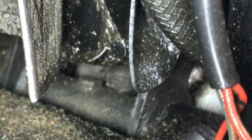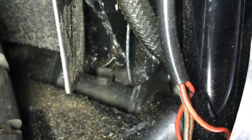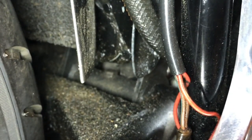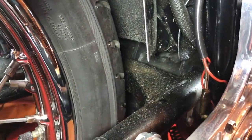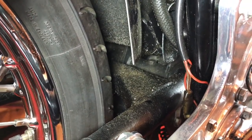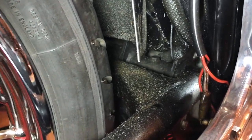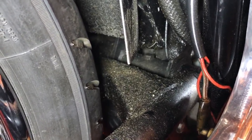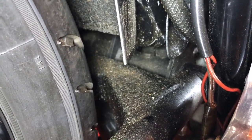It's a little grimy in there and I'll clean that all up as I start taking things apart. But you'll see right in the center there of the frame there's just a single nut — a locking nut — across that cradle bar, whereas I believe the Mark III has two cotter pin type pins that try and hold that spindle tighter. I'm very grateful to Fred and Ella Eaton for those technical features on the Old Brits site. I'm hoping to follow those instructions as I start removing all this swing arm, and we'll record it as we go.